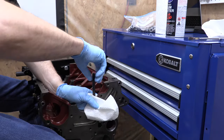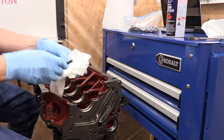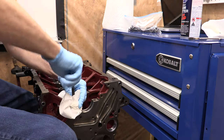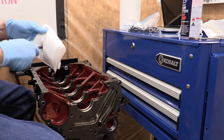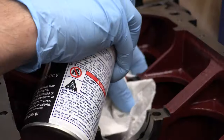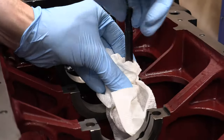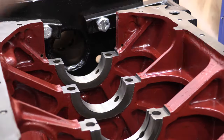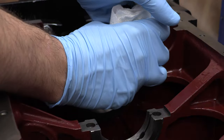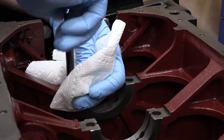Nothing is going to strip and prepare bolt holes and bearing surfaces that are oiled as well as this is going to do it. So you'll see me doing everything necessary to minimize its impact and to prevent damaging these coatings. What I'm doing is slow filling each bolt hole to top off the threads with a solvent to thin out all the goo. I'm inserting a stud, wrapping it in a paper towel, holding that firmly against the block, and threading the stud in to push the cleaner goo slurry up past the threads and into the towel.